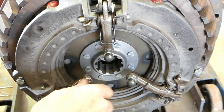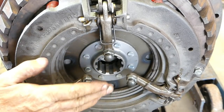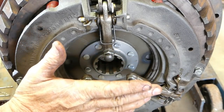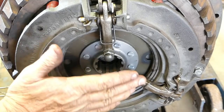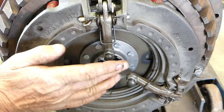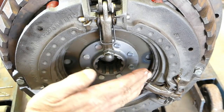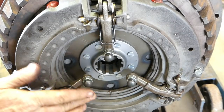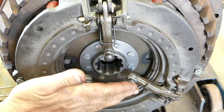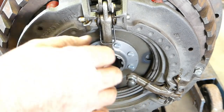Yeah, that can actually come down a bit. But look, once again, as your clutch wears, these fingers become higher and higher. At this stage with new plates, your fingers sit down a little bit, and you'll notice these screws are on a slight angle in, but as the clutch wears, they'll straighten up. But you must make sure you've got a nice radius here, so when the bearing pushes, there's no drag on these. You can just put a wipe of grease over them, but that's okay.